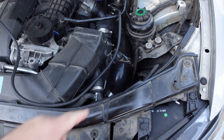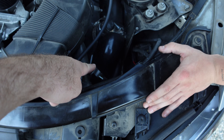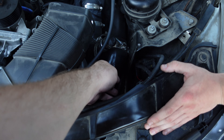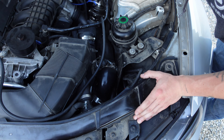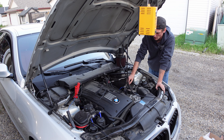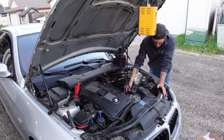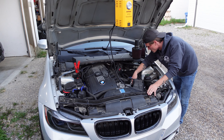Similar to what was on yours. So what you're gonna have to do is loosen both of them and you're probably going to need to pull it onto the charge pipe a bit more. This collapse here — that's not good at all. I'm just gonna grab all the air that's accumulated in the glove and push it all to see if it comes out anywhere else. It's coming out over here now, but it's still coming from the same fitting.